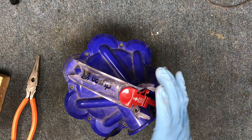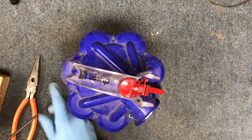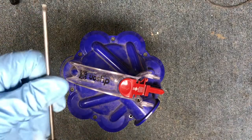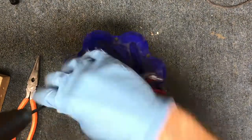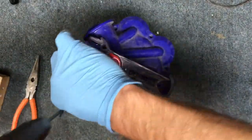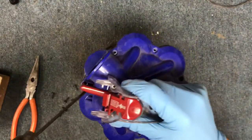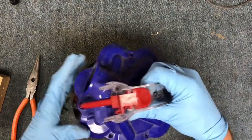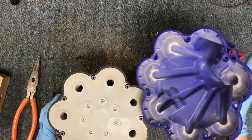Now you're left with the cyclone. You come in from the top, which is probably one of the easier cyclone assemblies. There are screws on the top here — these are T15 Torx. Take these screws out on the top, and then there's one more hiding right underneath this little red lever, but I'm able to get it at an angle.